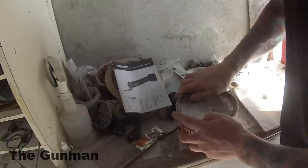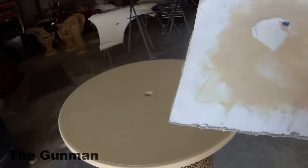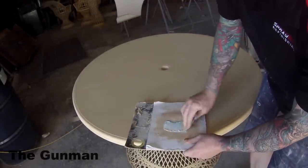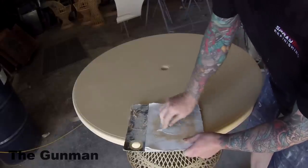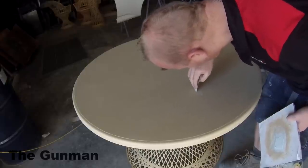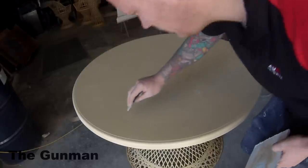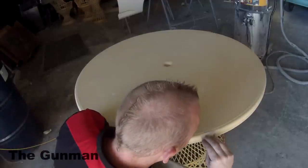It's very fine and not very porous at all. Some of the rough fillers you get are quite porous, and if you paint over them they'll suck all the life out of the paint. You really don't need much hardener — it's a ratio of about one percent. If you over-harden it you run the risk of bleed-through, because the hardeners have peroxide-type things in them. That color will actually bleed through even when you paint over the top of it. On the top here I'm being extremely careful, putting the filler into the low spots first and then pulling it out of the ripple-effect areas.